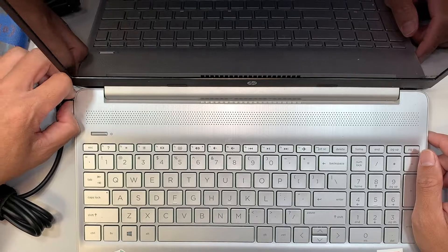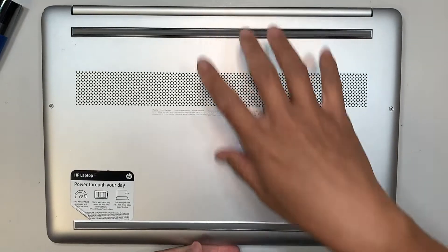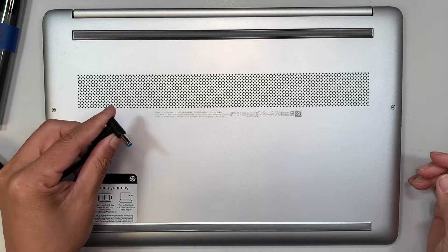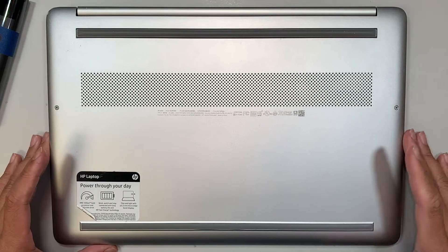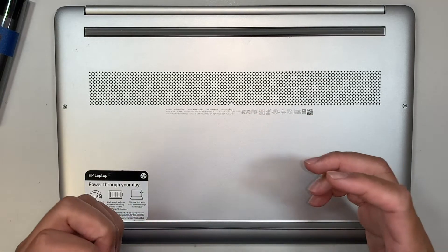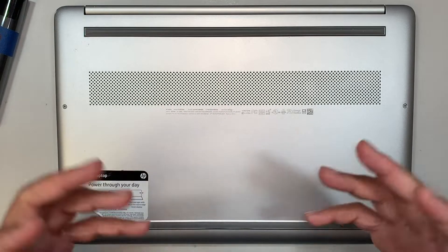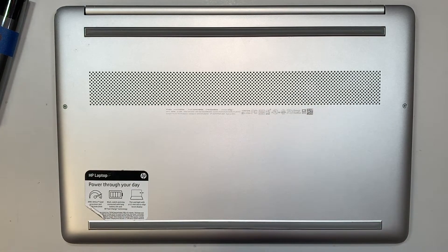What I'm going to do is try my best to troubleshoot the problem. I think the computer has a bad motherboard. The only troubleshoot I can do is remove the battery and do a direct connection from the power to the motherboard, hopefully bypassing the battery as it might be the cause of the issue. If that doesn't work, we can at least remove the hard drive and extract the data to transfer it to an external drive for a new computer.